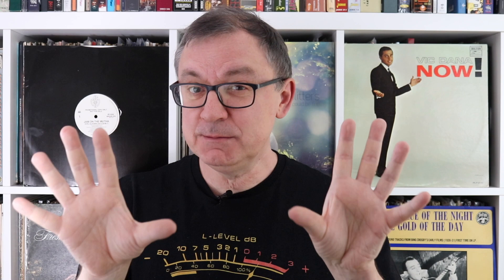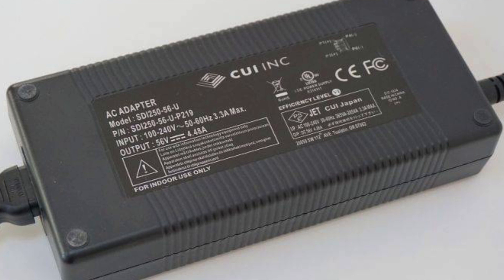In terms of the chassis, it uses an aluminium chassis, powder coated to give it a tough exterior. The BOSC amplifiers actually arrive as four separate items: you have your two monoblocks, and to power these monoblocks, they each have their own power supplies. So you have four items to contend with. This is great, because separating the power supply from the monoblocks lowers noise.